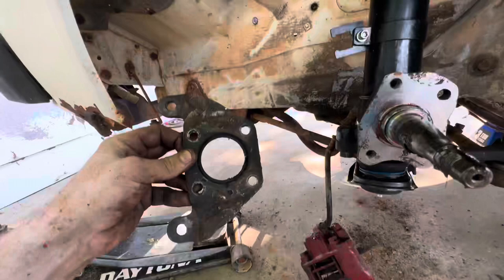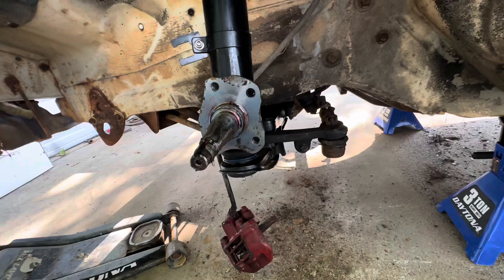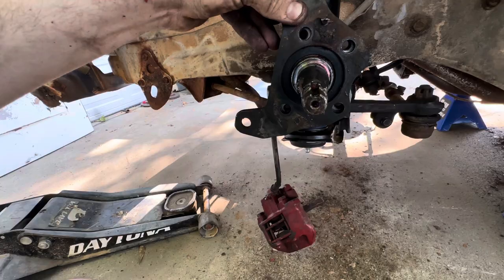For an AE86, it's this weird shape, not square at all. For a TE72, it's very square and unfortunately doesn't line up with any of those holes, and the center bore is actually larger. The caliper bracket is supposed to sit hub-centric on a flange in there. So the problem is the AE86 caliper brackets kind of need to have that, but this is what came on these coilovers.